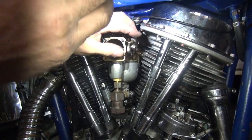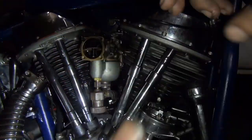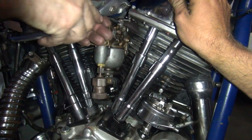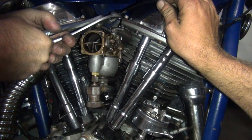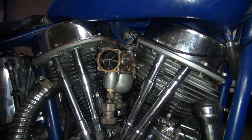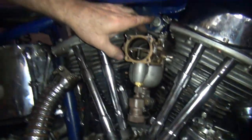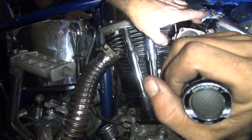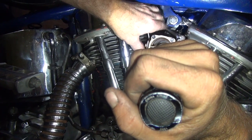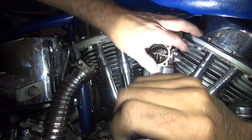Now if I take that and bend the piss out of it, hold that right there. I need that. Will that hold this? Pull that. Flashlight took off. Adjusted it. Mm-hmm. Now it's returning, see? Back to idle. See, it needs to be up. It's against the idle right now, so if it pops into a different spot, you lose throttle.